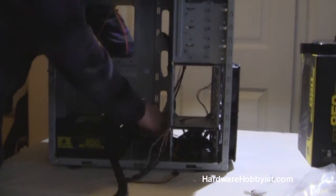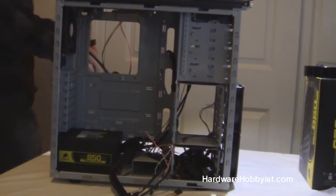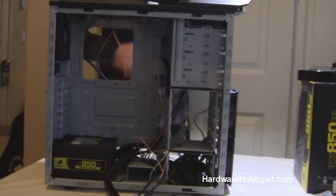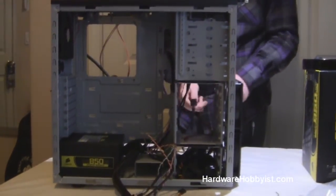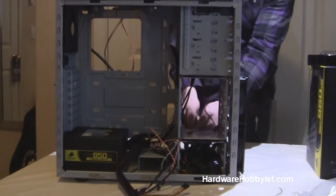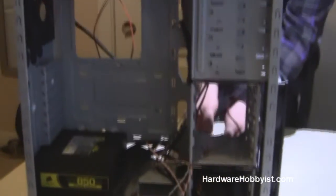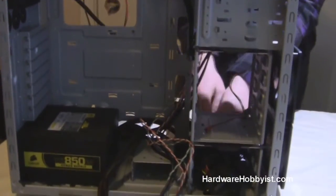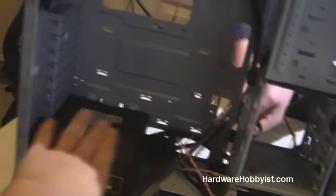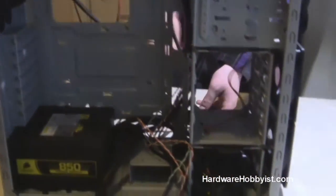So now you guys can see the planning that goes on with cable management. We know it's kind of long and tedious, but if you're one of those people that really want a nice clean looking case, it's just going to be one of the things you have to go through — and as you come to experience, you get better at it. Of course, what this helps is not only making your case look clean, but it helps with the airflow. For example, if you had a bunch of cables just over here, it definitely blocks the intake from reaching stuff such as your GPU or your CPU. So it has other benefits other than looks.